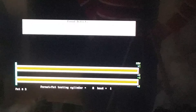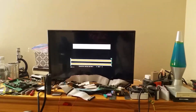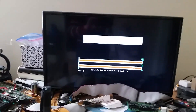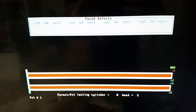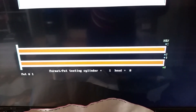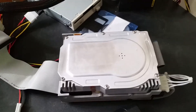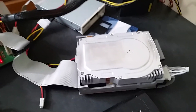I'll come back once something happens because I don't want to record the entire format. If you look a little closer you can kind of see the colors finally starting to come through — no defects, and it's able to scan through the drive sector by sector. So hopefully once this is done we'll have a working drive and we'll prove that we can use other drives with the MFM to IDE card.